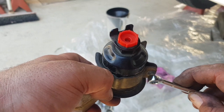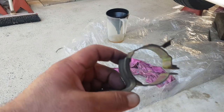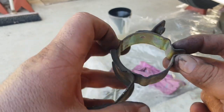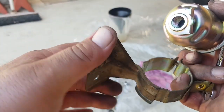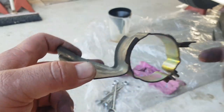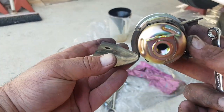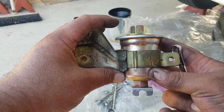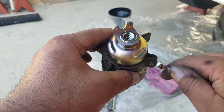Take your 8 mil, loosen it up, pop your filter out. Just remember to back this off only enough to slide the filter out. Remembering the mounting position — that's how it mounted on the body. Line that divot up — you can only go three ways, one, two, three, can't get it wrong. We remember how it looked when we took it off the body, and that's about halfway on the body. Now tighten it up and get ready to put it back in.